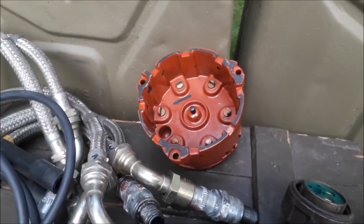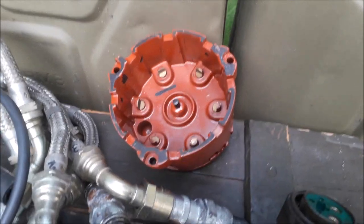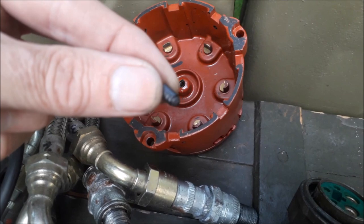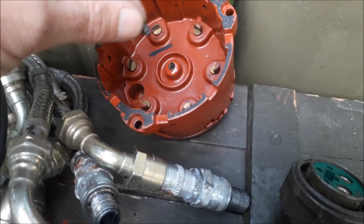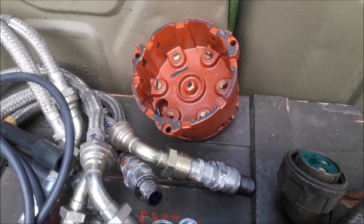Also electrically, the dizzy cap. Now it looks fine there really, but there are a couple of hidden cracks on it. And then we found the central electrode was just rattling around inside the distributor — that wasn't helping our sparking issues.